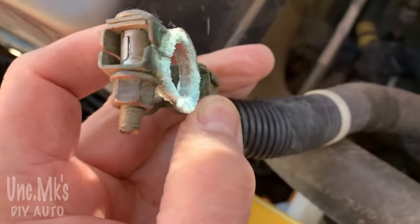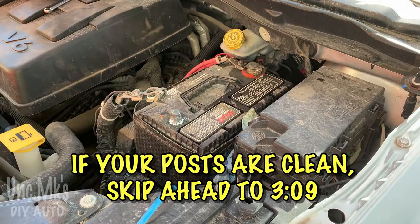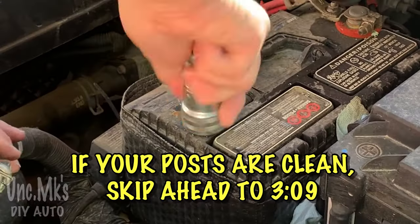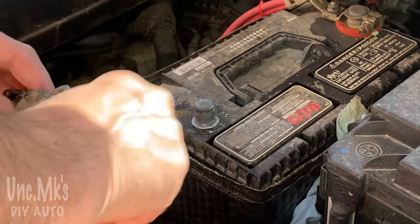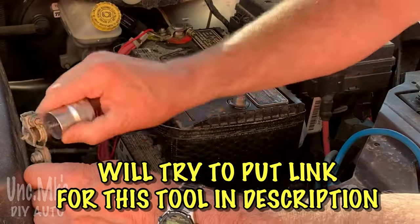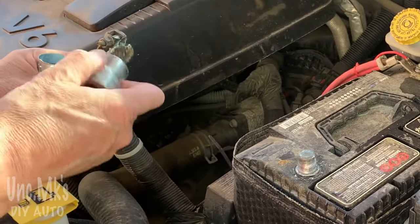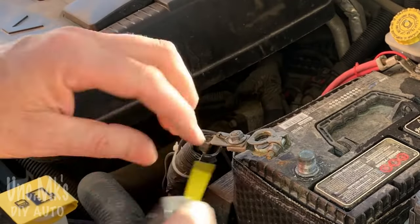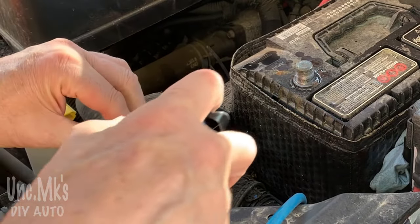Now, another problem. This is totally unrelated. If your posts are clean, you can skip ahead. But here, I'm going to clean them too. May as well while we're here, right? I'll try to put a link in the description for this battery post tool. You could use some baking soda and some water. I'm going to use this DeoxIT. This works good for anything that gets the greenies on it.